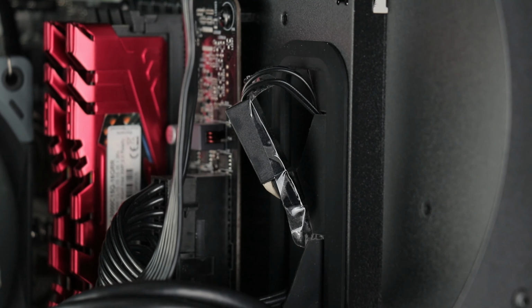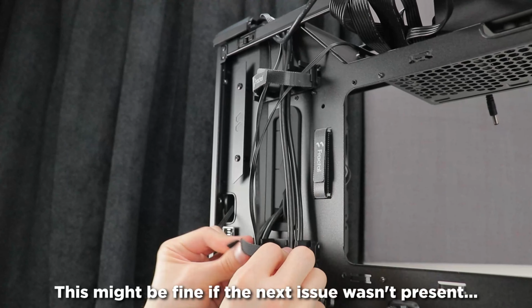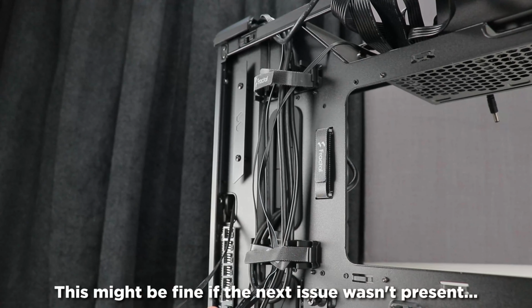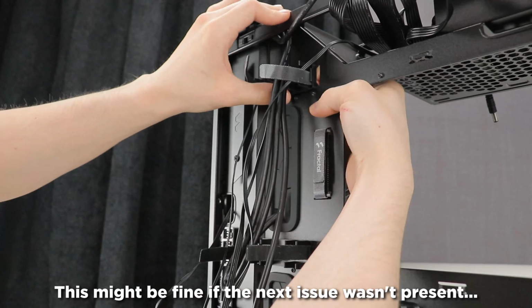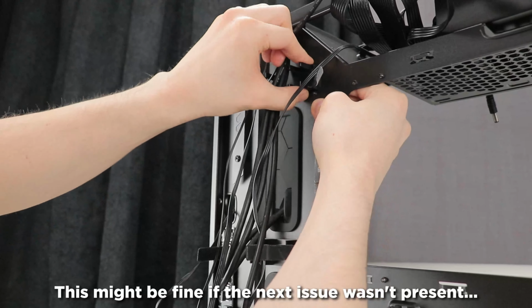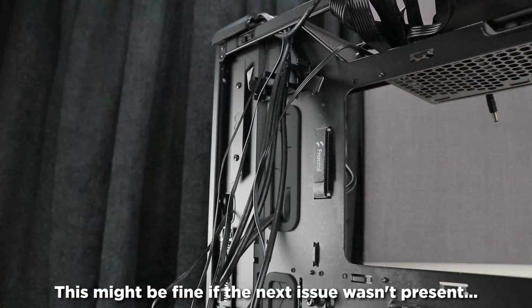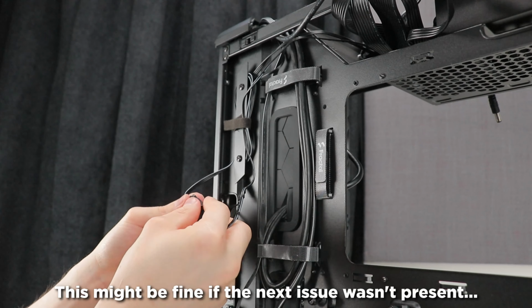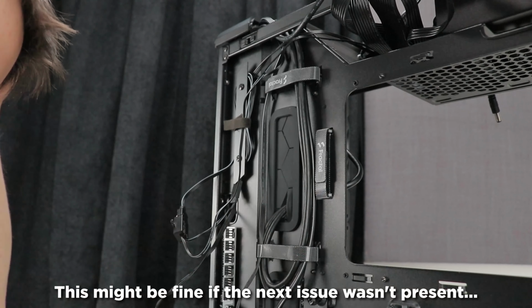The Velcro straps are great, but the plastic cable combs or guides don't add anything to managing cables, and they tend to force you to mix and match where the cables go between the guides as they go through them up the case. I found it's better to remove them entirely just by unclipping them from the motherboard tray. Why have chunks of plastic wrapped up in the strap when you can get rid of them and have less going on in the strap?